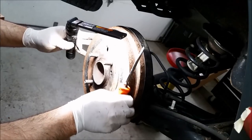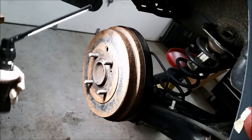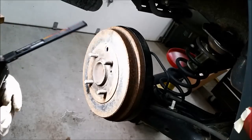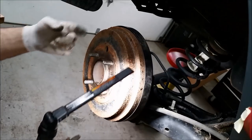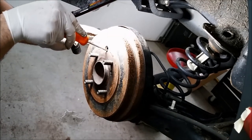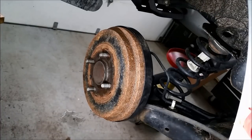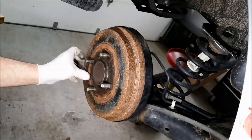Back the car up a couple of times and hit the brakes nice and hard, because technically they're only going to adjust going backwards. If you don't go backwards enough and hit the brakes hard enough, the self-adjusters won't work. By design, when you go backwards and hit the brakes, the shoes push open, that arm comes up — it really doesn't do it going forward, only going back. Back the car up, give the brakes a good hard shot, they'll adjust up a click — do that a couple times, two, three, four clicks, and it'll kind of find its own happy home. That's feeling real good. Put the plug back in the hole.